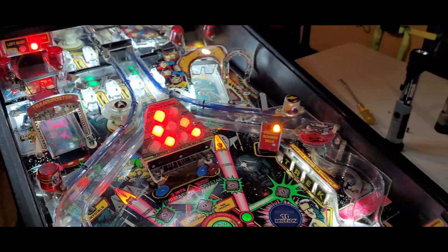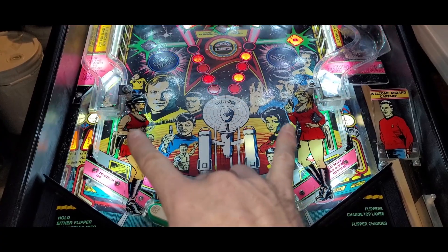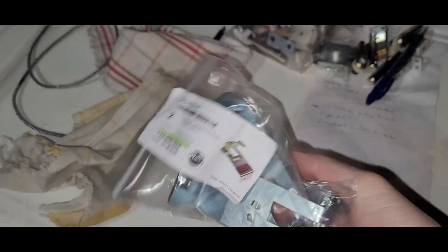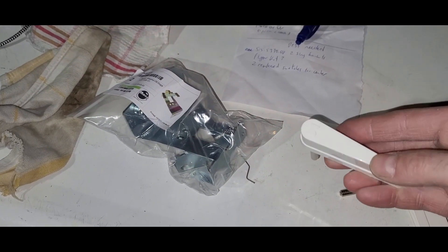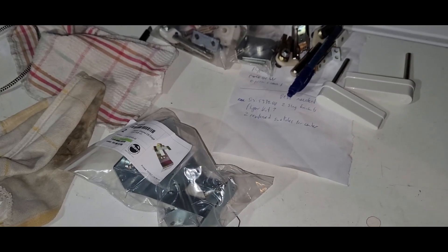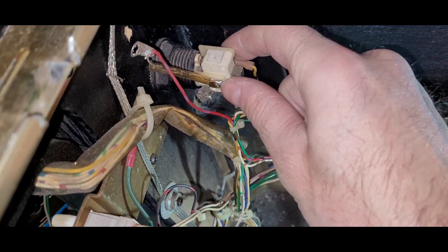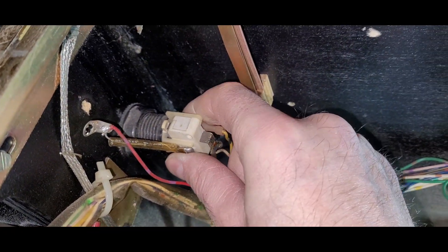I'll put the table away, then I'm going to fix this flipper diode. And then maybe I'll change the brackets for the slingshots — that probably won't take a whole lot, just a few screws. Don't even need to desolder the coils, right? Then I'll deal with the flipper rebuild later. I thought I would change this bulb and this start button. These things are always such a pain to remove — but this one was actually not a problem, probably because it's been messed with enough times.